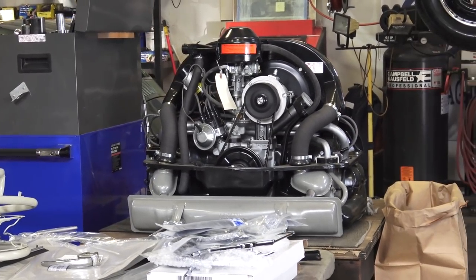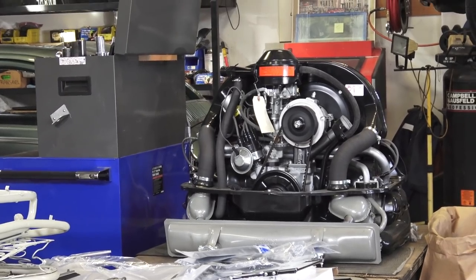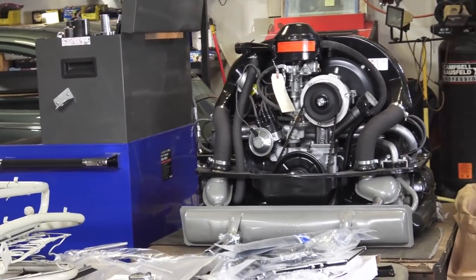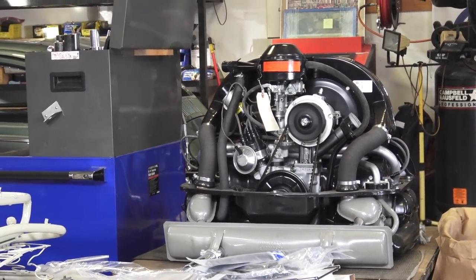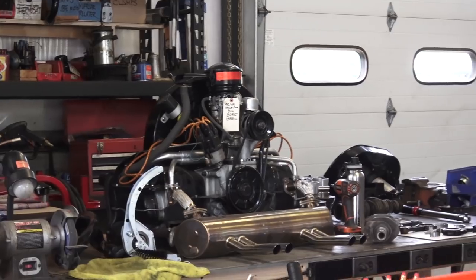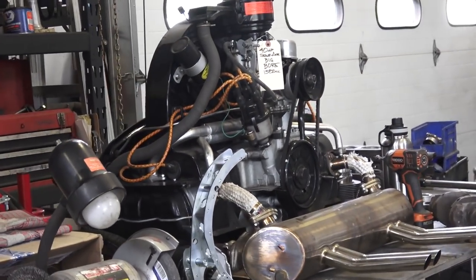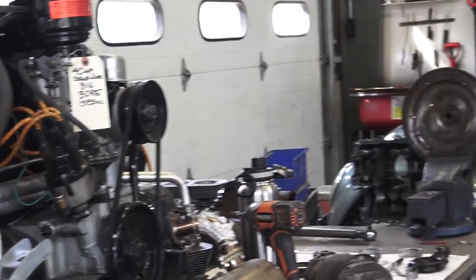Say the car is all done — what do I mean by break-in period? Rick Higgins, I learned from back in the day when it came to rebuilding motors: a break-in period is basically about a 300 to 500 mile period just out of the gate. So the car is all done, and the first thing you really want to do is run it for about 25 minutes, half an hour, or 25 miles — something like that — and break the motor in just a little bit.